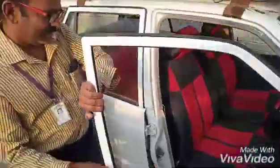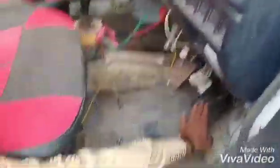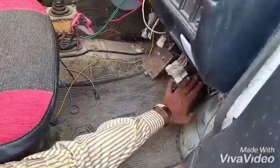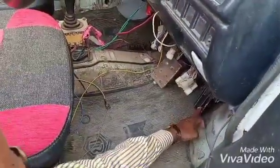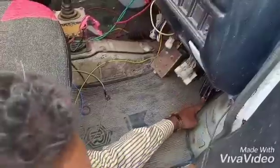Sir, can you tell us about the E-Rickshaw kit that you have used? I have bought that E-Rickshaw kit. It comes with differential, motor controller, and accelerator. Here I have put the accelerator - you can see here. The old accelerator was removed, and now this is actually the throttle - hand throttle - which is converted into a pedal throttle to make a mechanical adjustment.